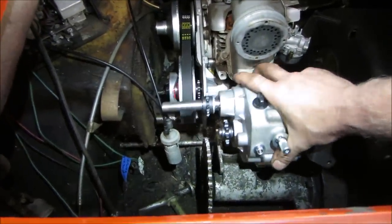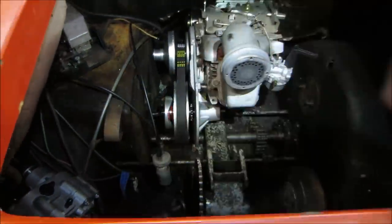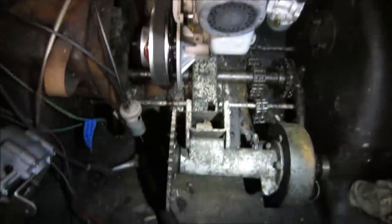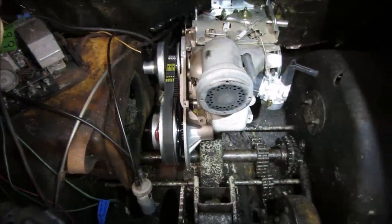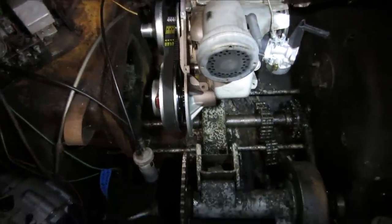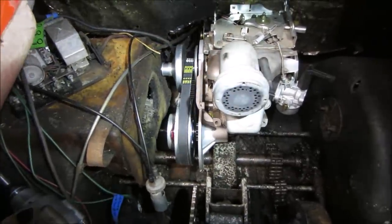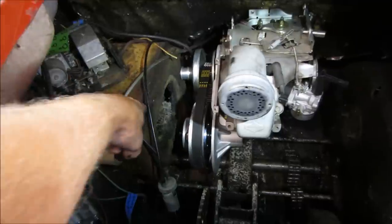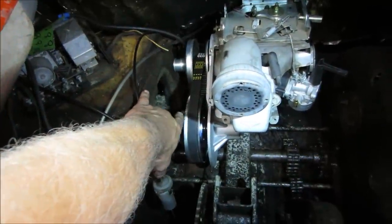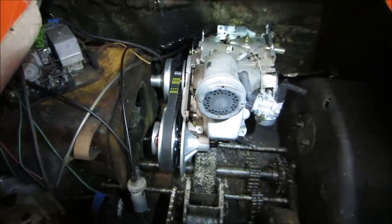I think for now the next step is to take this thing out, fresh wash it, get all the crap washed out of it, and make it a little more enjoyable to work in there. Then we can make more stuff permanent and be able to weld onto things. Get the nest out of it. As far as the intake, I was thinking - can I run a boot up through here? The air originally came in through the passenger compartment through this box. The original fan sucked air in through here, but on this engine the fan is on the other side. That's kind of why I wanted to flip the engine around - if I could put the fan in front of there.